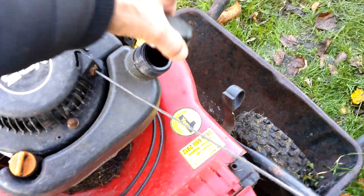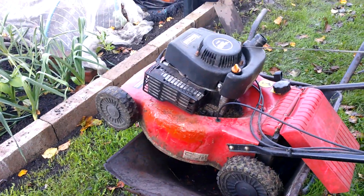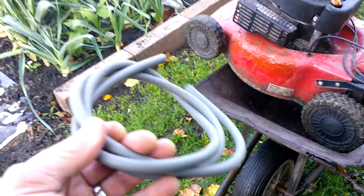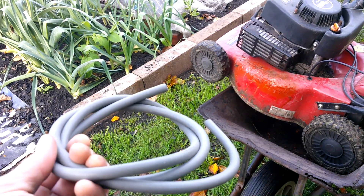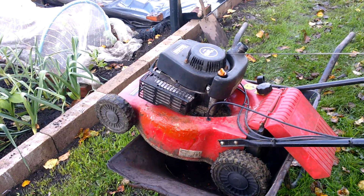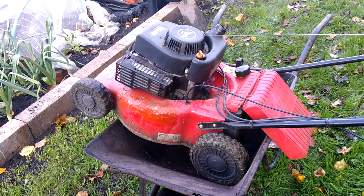The other job I need to do is get the remaining fuel out of the tank here. I don't actually think there's that much in it — can't really see, but it's not a whole bunch. I need to get it out though — you don't want to be leaving fuel in your machines over winter, it gunges up the carb. I've got a piece of siphon tube here and I'll just see if I can get that fuel out. Once I've got most of it out I'll start it up and run it until it's all gone, and then it should crack up pretty much on the first few pulls next spring.